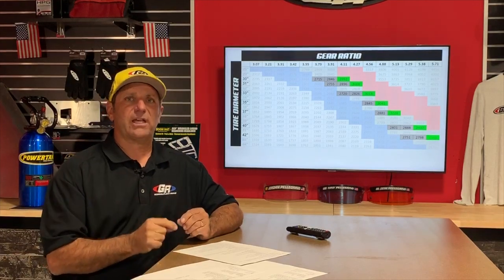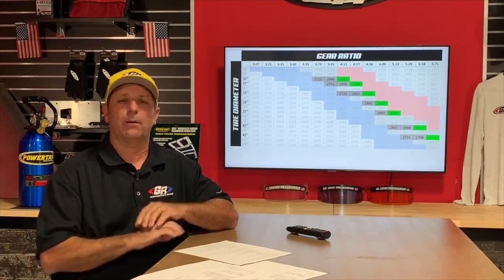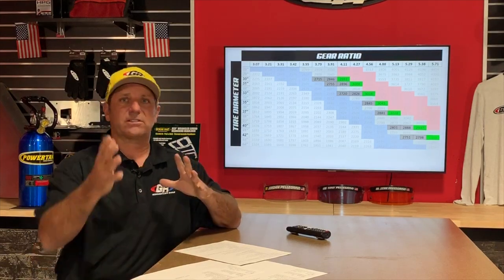Eric Brady comments that the gas tank may not be CARB legal. Our gas tanks are CARB compliant — they reuse everything associated with your evaporative emissions system. The vehicle's OBD2 system can't distinguish it from stock. If you don't volunteer the information at the smog station, it'll fly right through.